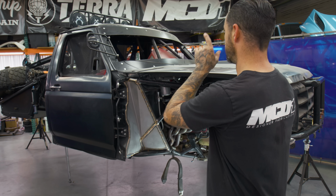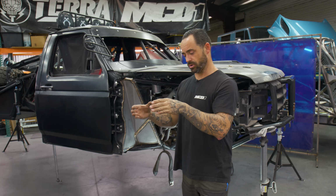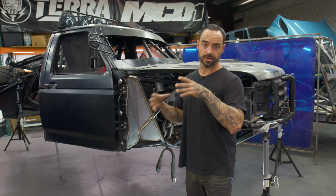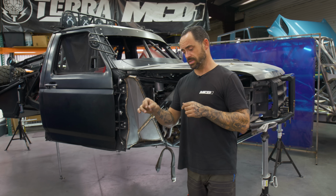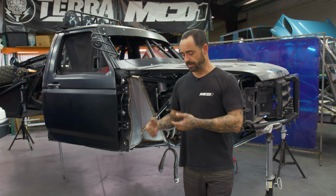So we have brackets and everything reconfigured in the car where it works. We moved the shifter over and got the handbrake right next to it, and then all the center console is going to fit right back on where we don't have to do any kind of crazy modifications. The other thing is moving the shifter away. There was a request to swap some of the switches in the center console because the ignition switch was right next to the shifter, so sometimes they'd bang it and cut the car. Now that the handbrake is there and then the shifter, it's got that space farther away.